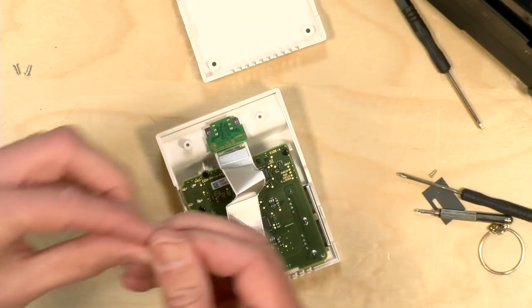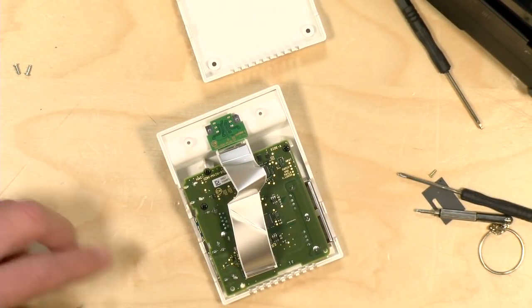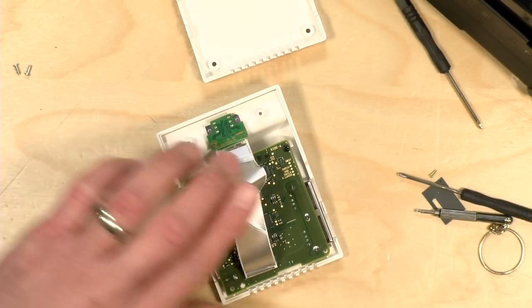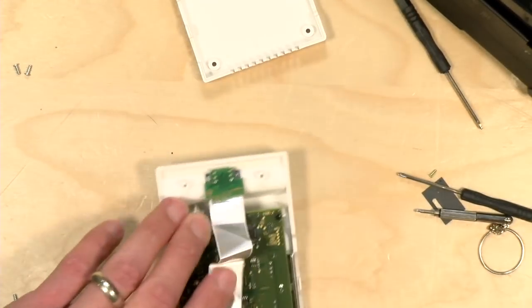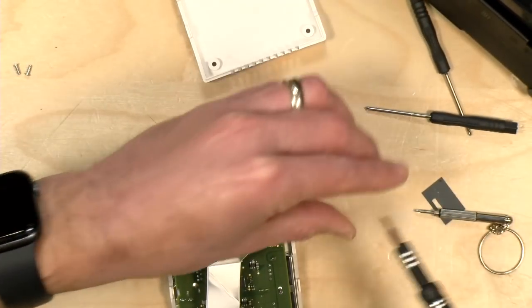All right, 3, 2, 1. Now, before we screw down the USB-C connector, you need to take the 2 screws that were on the original Nintendo dock and attach them here. So all the other screws you're going to use on this project came with the dock, but these 2 screws will come from the Nintendo dock. And those are these tiny little screws that we had to get a different screwdriver out for. So I'm going to attach that to my screwdriver here and get these installed. Then hopefully we should be able to put the whole thing together and get our Nintendo Switch working with the original hardware in a much smaller form factor.